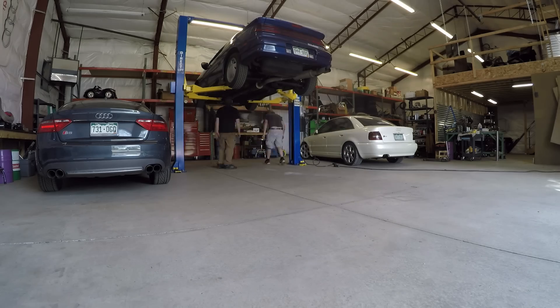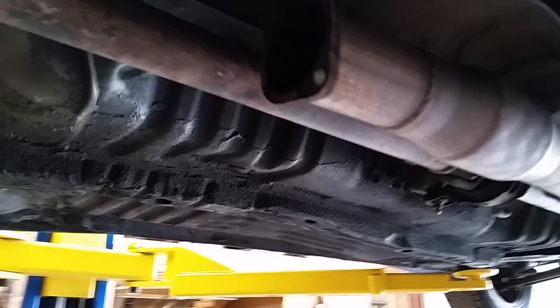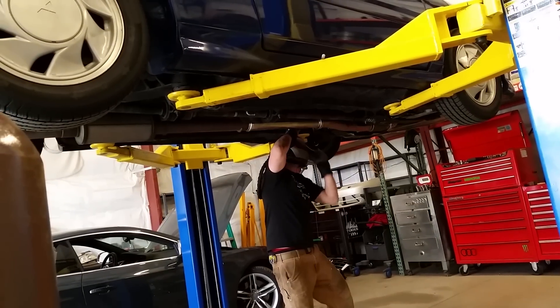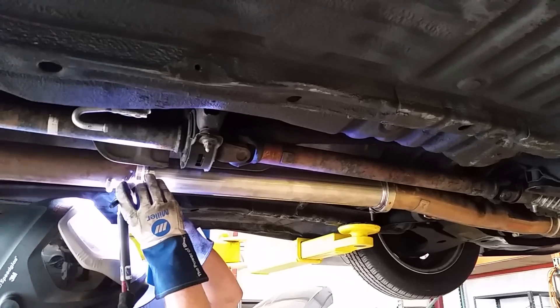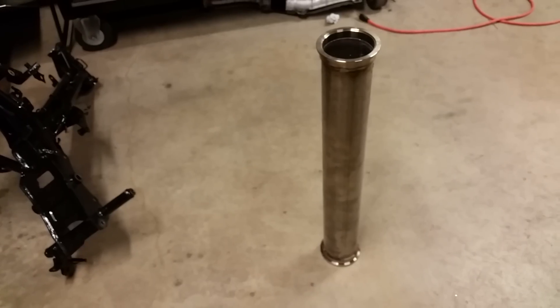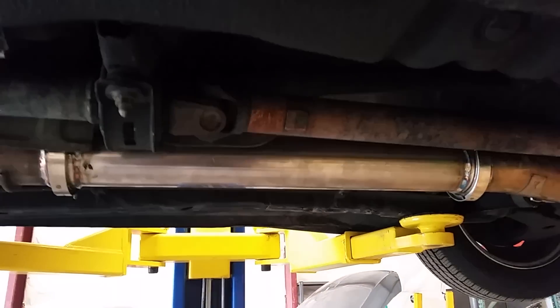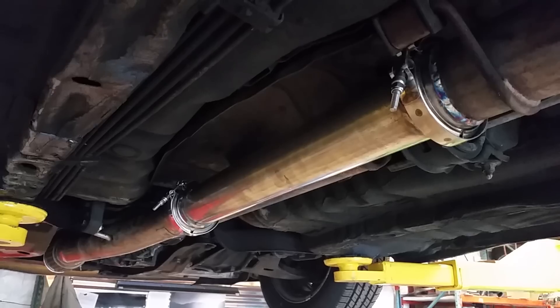The last thing is to get rid of the catalytic converter. Prolonged excessive back pressure is what killed my last turbo, so we're not taking any chances — it's back to Willy's shop to cut it out. We're adding a 3-inch section of straight pipe where the cat used to be, using V-bands to secure it so I can easily swap the cat back in when it's time to pass emissions. I was completely spoiled by the lift there — I really need to get my own space on a lift. It made this job an absolute breeze.